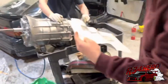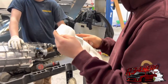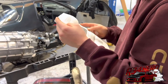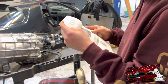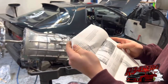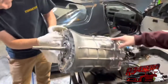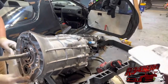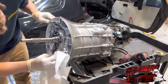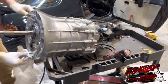What's next? Make sure there's no fluid left in the transmission. Remove the stock input shaft from the front cover and gasket. Clean off where new gaskets will go. If you have an HR or VHR trans, you'll need to put the adapter ring over the large bearing before installing the bell housing. Use new gasket and install bell housing — the socket head cap screws will go on the bottom side. The bottom four bolts will need seal on the threads. Torque bell housing bolts to 13 foot pounds.